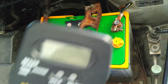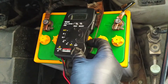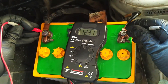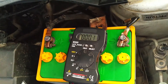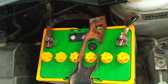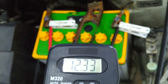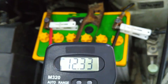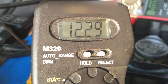If you don't have an auto-range multimeter, turn your selector switch to 20 volts DC. Connect your red or positive probe to the positive post of the battery and the negative black probe to the negative post. This one is at about 60% charge right now — just to show you that a good battery will start your car even when it needs some charging. With the probes still connected, it is time to start the car and note the values when a load is applied. The load in this case is what the starter motor draws from the battery to turn the crankshaft.